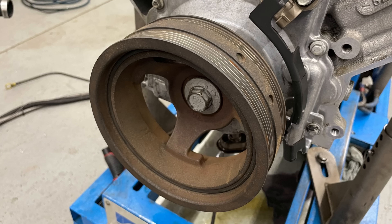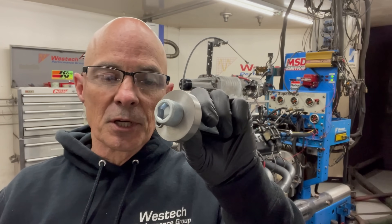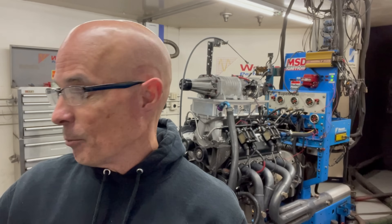We're going to try to make it so that the damper stays on. I'm running the stock truck damper right now, but what we're going to do is use this first — we're going to drill holes in it, put a pin in it, tighten it down with an ARP bolt and see if that'll stay in place. Then later on, I'm going to switch out to the bigger and better ATI damper, secured with a different style pin. The belt won't come off, the pulley won't come off. It'll be a lot better.